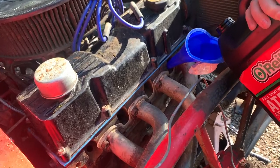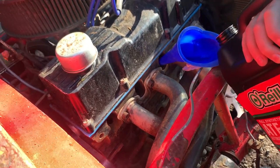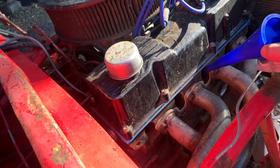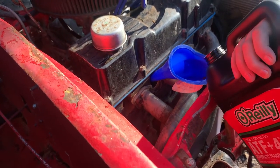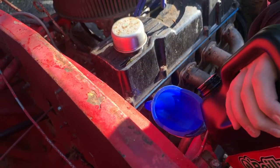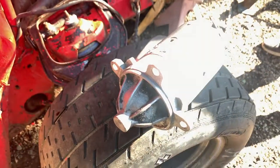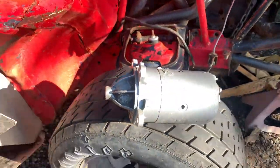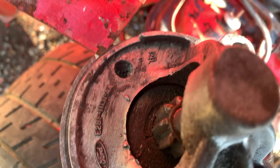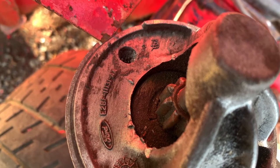I did get some water in the oil or watered down the carburetor. We thought it would be a good idea to pour a little bit of ATF in each cylinder since we're going to be cranking it over a lot before it fires — we want to make sure we don't score up the cylinders any more than we have to. This is a good way to get oil into the combustion chamber. Starter rebuilt with silver spray paint and ready to go back in — there's the part number if you're wondering what starter I'm using.